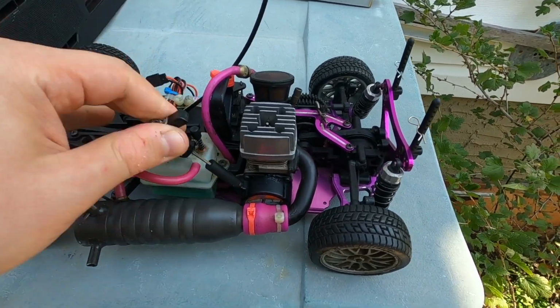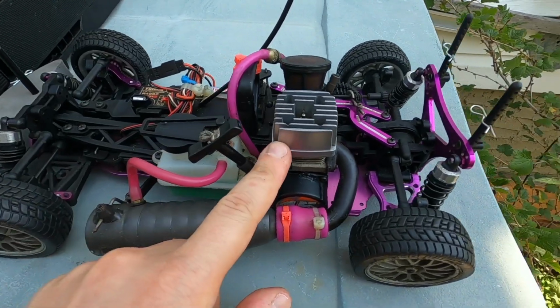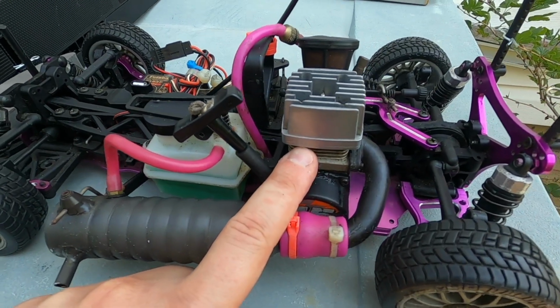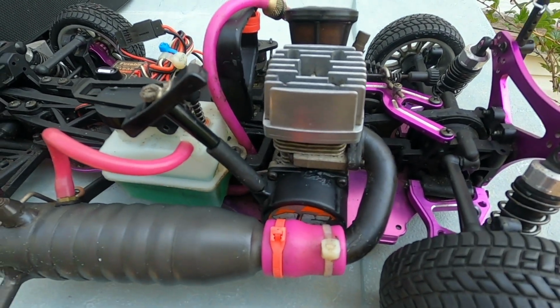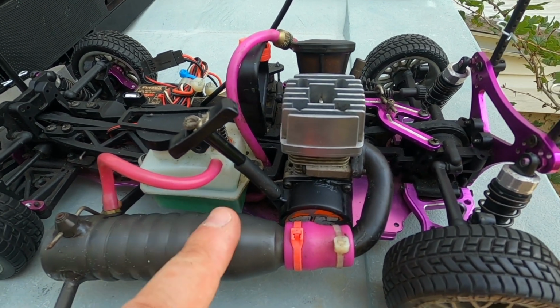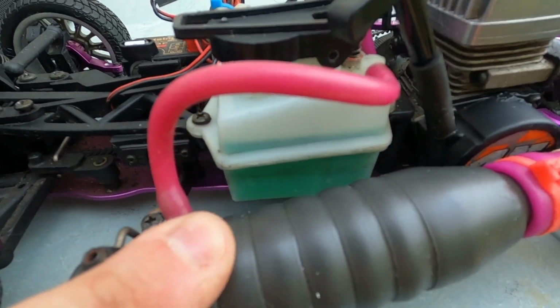Pretty adequate compression for an old motor like this. And these old .15 motors were ABN design, not ABC, so over time you have pretty high compression losses. Even if people ran about a gallon or two through them, you would notice an obvious decrease in compression. This one is okay. It also came with very old fuel, but no big deal.